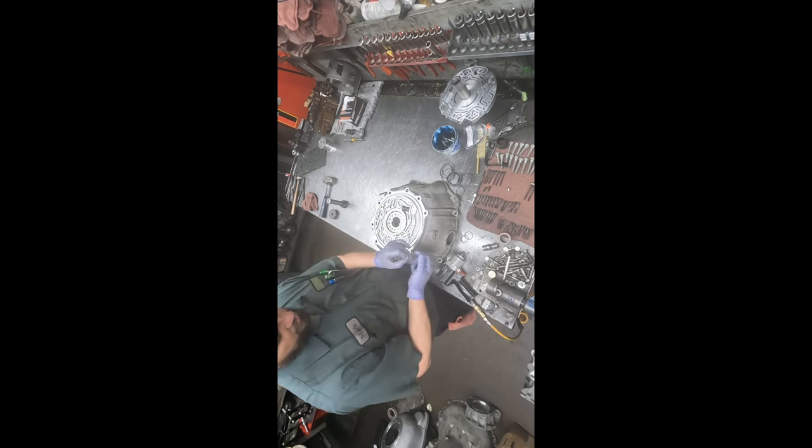While I'm not really the greatest at this, my coworker is really good at this. He used to be an aircraft mechanic, I guess he had a lot of practice at doing these. I'll bring it back here to show you the pliers I'm using. As you pull them, it's got that corkscrew up there that allows it to spin the pliers. And so that's just a method of holding this pin in if it starts to walk.